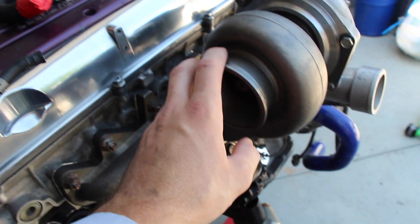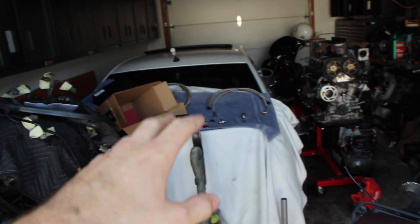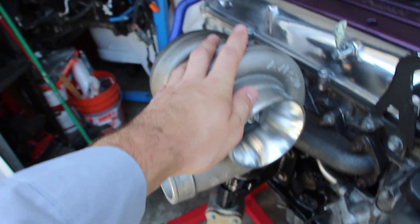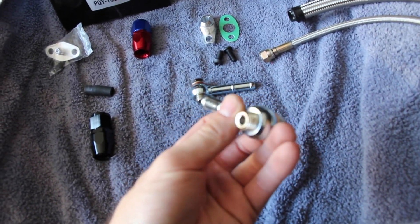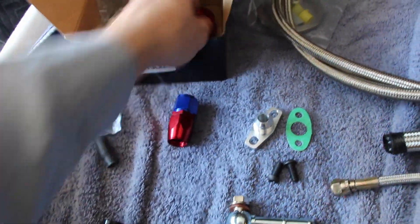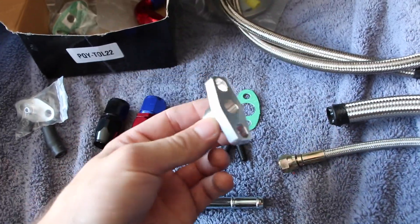Still working on the downpipe. The oil lines and water lines have been a pain — I ordered the same kit I used on my other build, but nothing is working on this motor. The oil feed is still in the mail since it needs to be a special size with a restrictor, because this is a dual ball-bearing turbo. I ordered water line fittings that came today, but I thought they were dash-6 and they're actually dash-8, so I need to order 5 feet of dash-8 line. I also ordered a Vibrant oil drain for about $25 — it'll fit the bottom of the turbo perfectly.